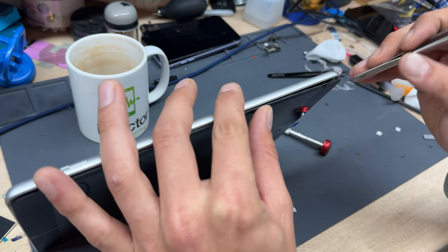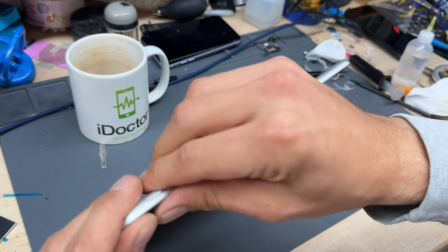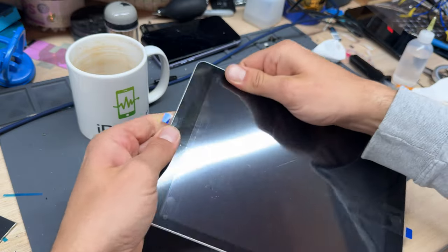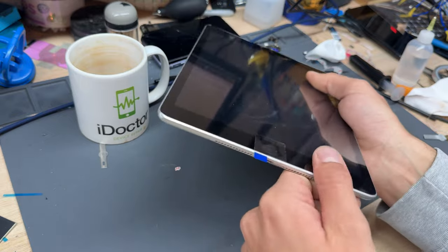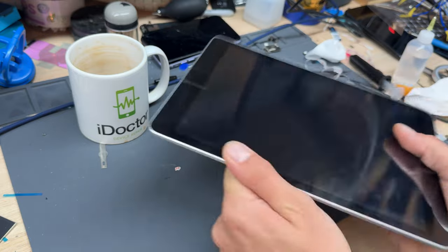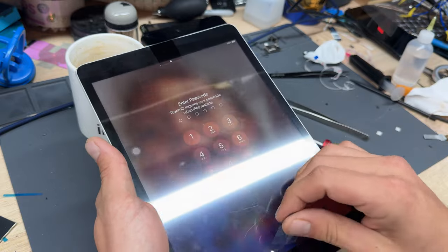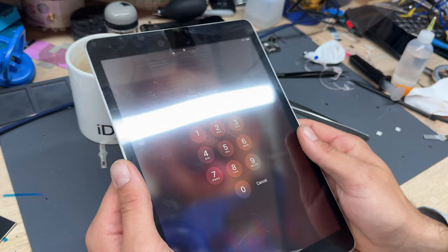Peel away the remaining bit of adhesive and make sure these two cables don't get snagged on the chassis whilst closing up. If it's catching a little bit, use the back end of the tweezers to push it down and guide it in — same with the home button flex cable. Then give the edges a real good squeeze. There's no need for clamps — the adhesive on there is solid and really good. Just make sure it's stuck down all the way, nice and secure. Once the plastic film is removed, this iPad is ready to go back to our customer. Thank you for watching and see you next time.